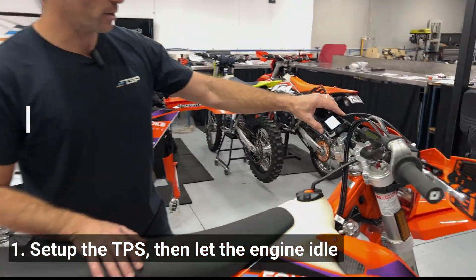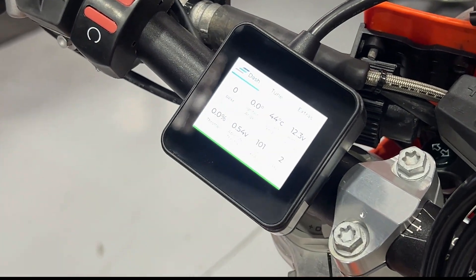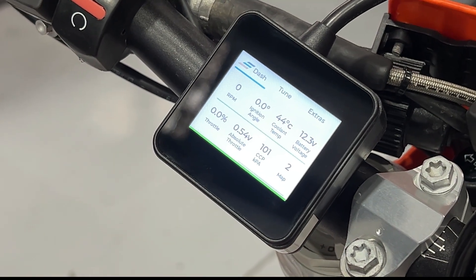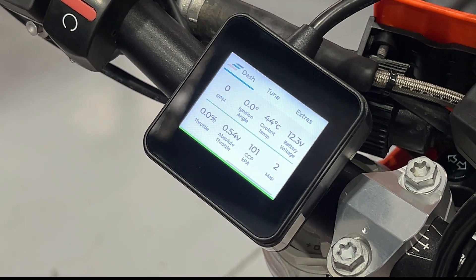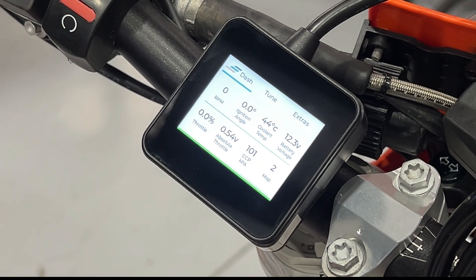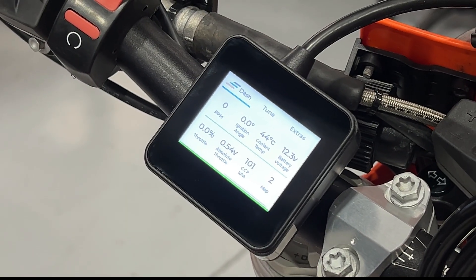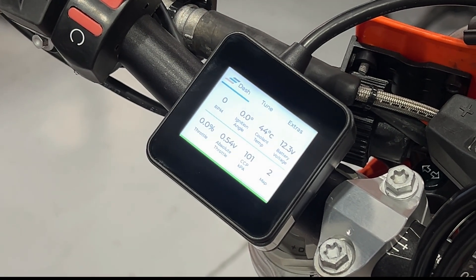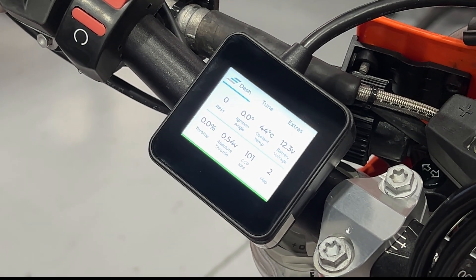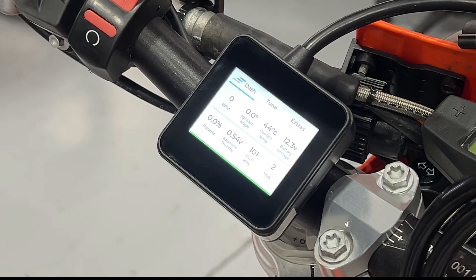First, if you come over to the ERM, you'll see on the dash screen near the bottom our current closed throttle voltage is 0.54 — a fairly standard voltage for a bike that idles normally. What we need to do is back off the red and the yellow screw-in adjusters on the throttle body and make sure there's some slack in the cables. Then we need to check the voltage when the butterfly is fully closed and make sure it's exactly 0.40 of a volt, which is the factory spec.